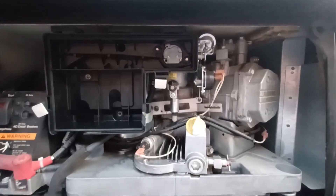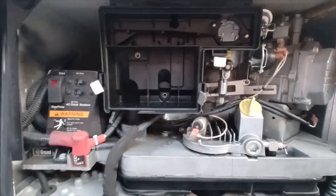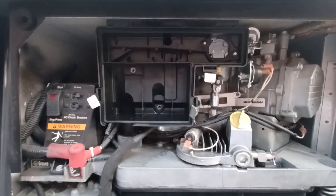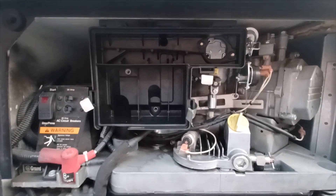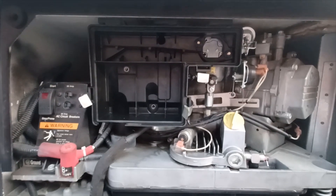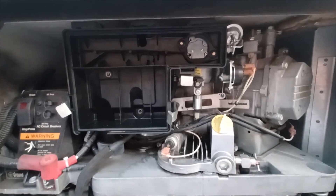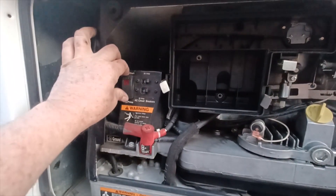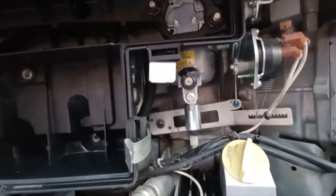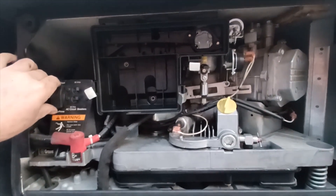I got the carburetor back in place with just the two bolts so the gasket seats. To recap: we knew we had compression — you can check that by pulling a spark plug, putting your finger over the hole and cranking; if it's kicking hard and spitting, you've got compression. We knew we had spark because it ran on carb cleaner. We knew taking it apart there was varnish — the green death — in there. It's back together, so let's run the primer pump to fill up the bowl and give it a try.